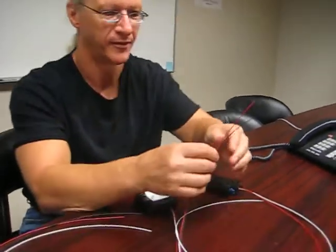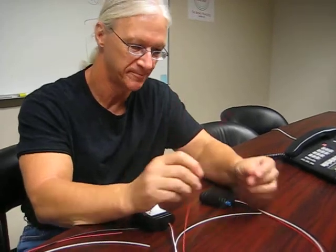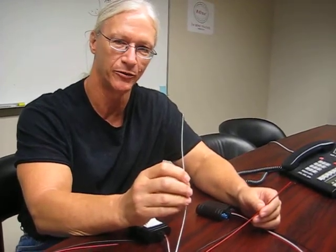Would I want to use this on a piece of farm equipment that doesn't have a battery on it? No, these require constant power. The correct connection method is: the black wire goes to ground, the red wire should see 12 volts DC at all times regardless of key position in the vehicle. The white wire is your ignition sense wire and should only see 12 volts whenever the key is on, and zero volts whenever it's off.